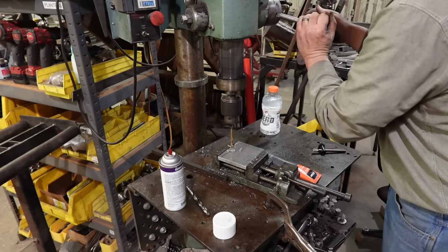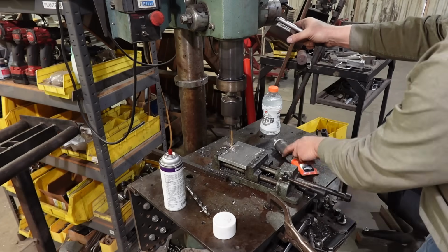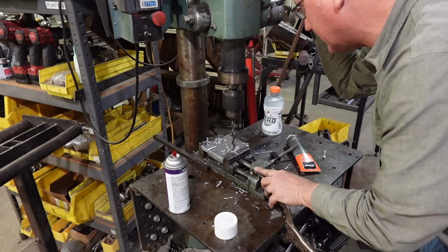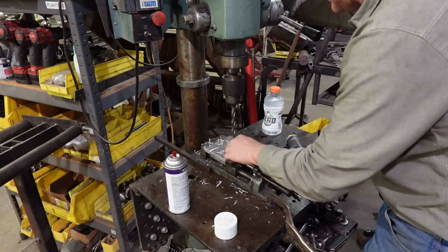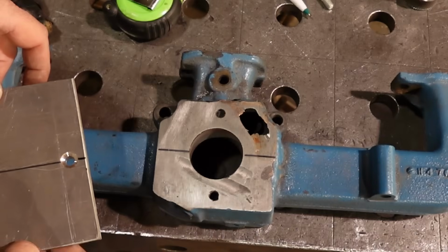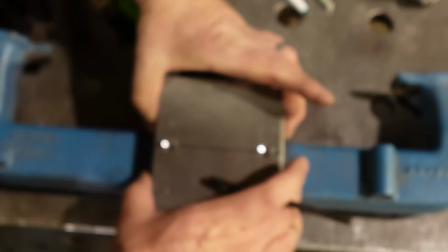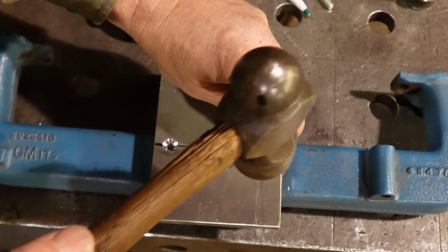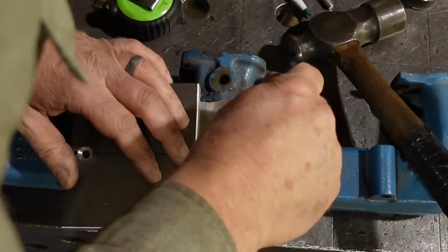Oh. Speed doesn't want to bite. And while we're at it, we'll put our countersink for our head in. Now I've placed a good enough center line on our manifold and on our plate, just lining those up through the holes. Not too critical. Could use a transfer punch from an incomplete set, so it's not quite the right size. Oh, are you gonna get me in trouble? That just broke right through that.